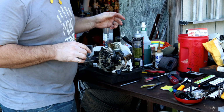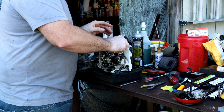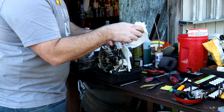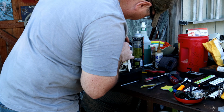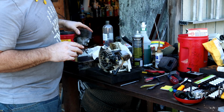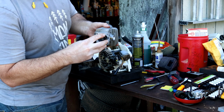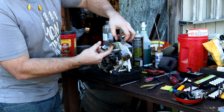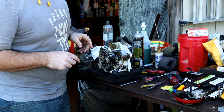Yeah, just make sure you're double checking everything. Again, when I put my piston on, I don't have any sort of tool to crimp down the piston rings. But like I said, you have to line them up with a little dowel and then kind of squish them together as the cylinder is going on there, and get down, look up under there, and there's a nice chamfer on the inside of this, which is going to compress it as it goes in. So just nice and easy. Don't use a hammer or anything. Just hand pressure and moving this around as you're getting it back together. Got my gasket made. I'm going to get this back together and then we'll fire it up and see how it sounds.